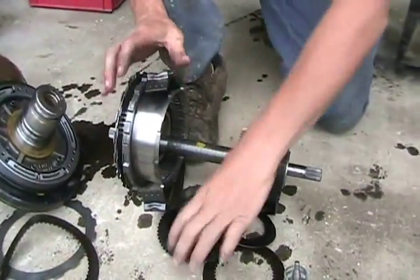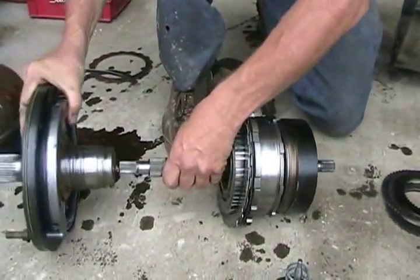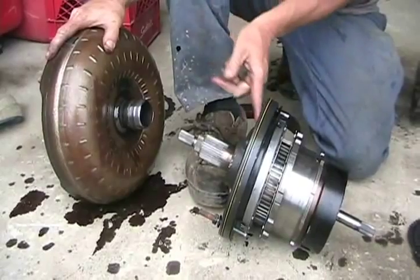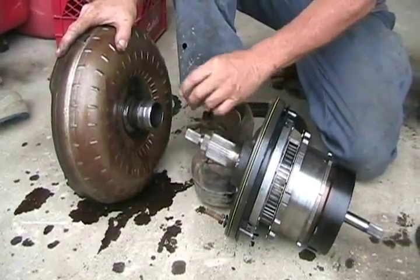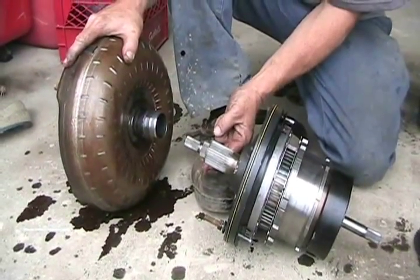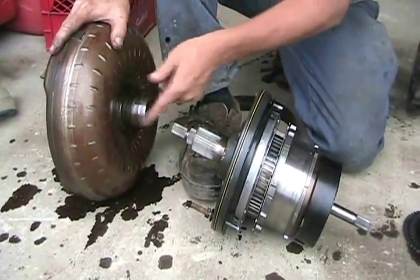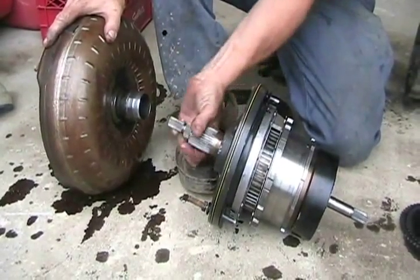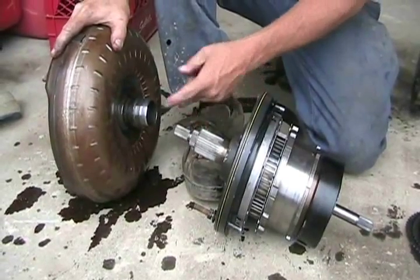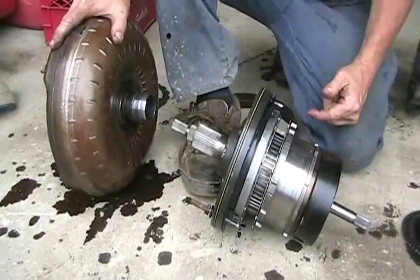This is the input shaft. This is the oil pump drive shaft. The torque converter always needs oil pumped into it, because without it, gravity causes oil to leak down to the middle and run back into the oil pan. As soon as you start your car, it rotates this shaft, pumping oil through the spaces around here to keep the torque converter always full of automatic transmission fluid. This stationary shaft stays in position, affixed to the transmission. The input shaft carries all the power from the engine through the spinning torque converter to drive all the clutches and gears inside.